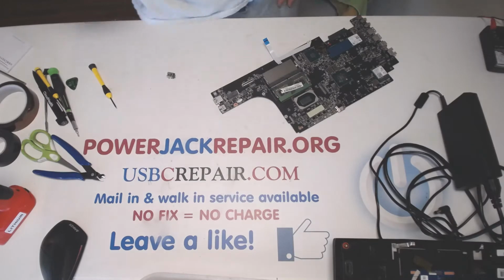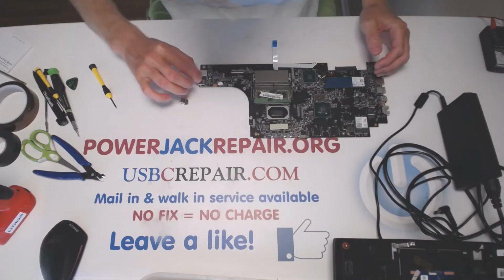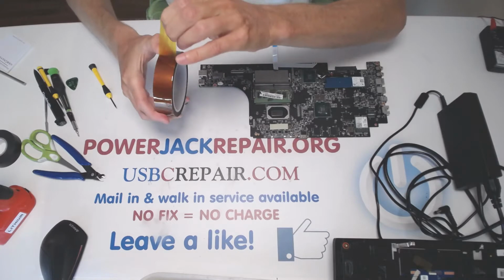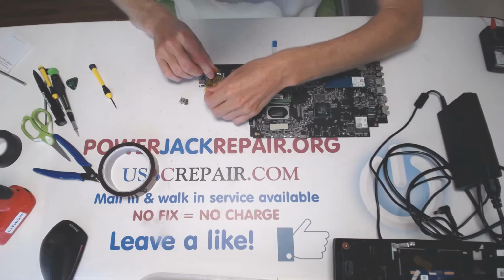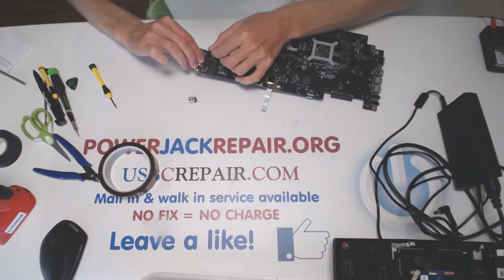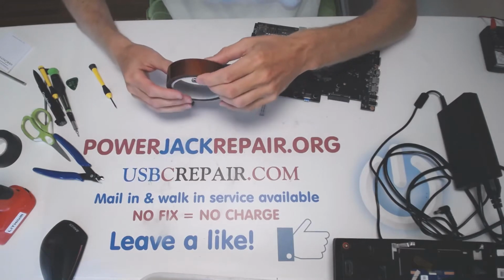So the way to desolder this jack: there are lots of little components nearby, so we need to insulate the area around the jack the best we can. And for that we use this Kapton tape. We just put the Kapton tape like that. On the bottom there are not that many components, so nothing to worry about, just the top.